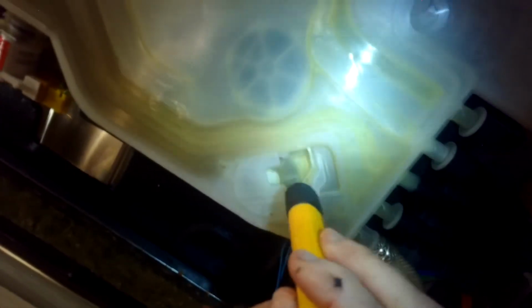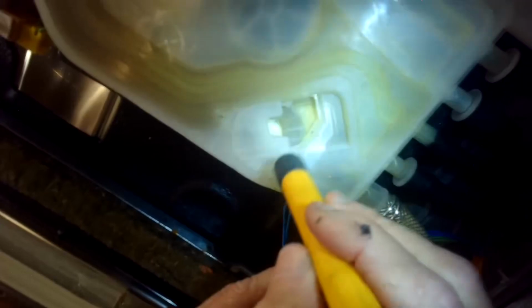I believe it's magnetic, so that's why it's moving as I move the screwdriver that has a magnetic tip. And this senses that magnet moving. I think the problem usually is this little diode. So you get this new part from Miele USA and just slip it in there, probably cure your problem where you're getting some of these codes and your dishwasher just is acting strange because it's not able to sense how much water is coming in. It's a pretty powerful magnet at the end of this flashlight, and I don't know if you can see this on video, but I'm moving that wheel around because it's got a magnet on it, and it's moving very easily. So that's a good sign.